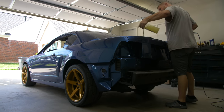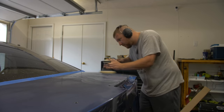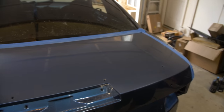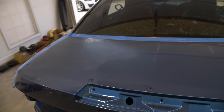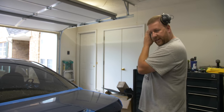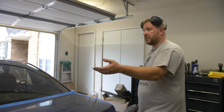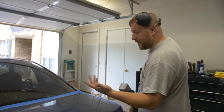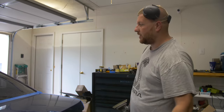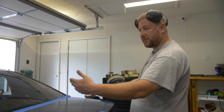And then we come back down to earth and see the difference between 1500 grit and 2000 grit. Getting it smooth from 1500 is really the longest process — getting it flat before you start coming up through the grit and polishing. The hardest part is just getting it flat right off the bat. This is the easy part: work in small sections, two foot by two foot, do one side then the other, and don't move ahead — work on one spot until it's completely done.